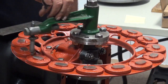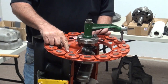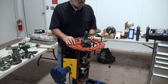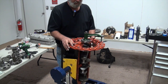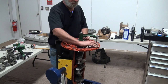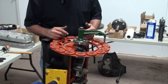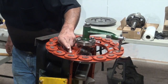Right now I'm kind of touching here and not touching on this side, so I'll loosen this up and take a shim out of this one edge. The goal is to get it square, where it touches all the way around. The earlier magneto rings were a thin stamping and needed more clearance because the magnets would pull it in. A lot of guys like an extra five thousandths or so. I usually just set mine up at about 30 thousandths gap and get on down the road.